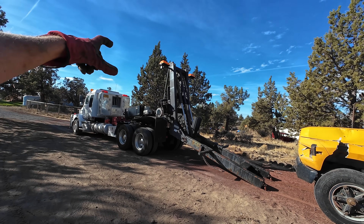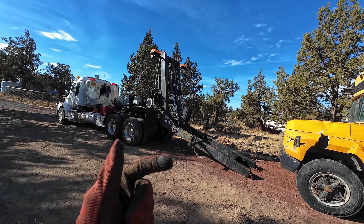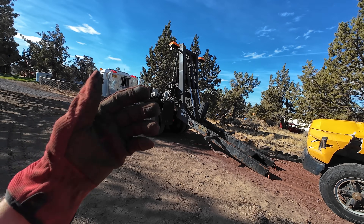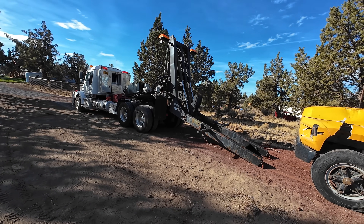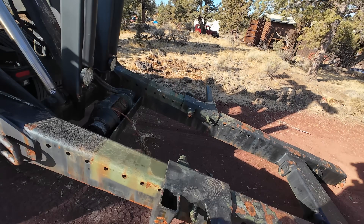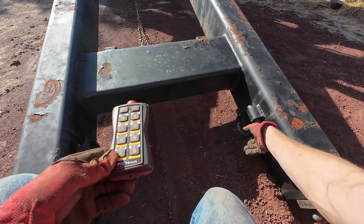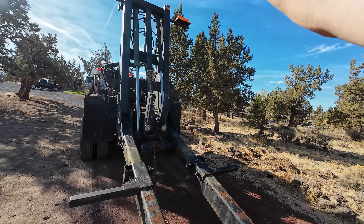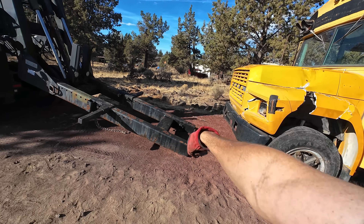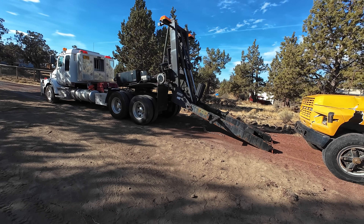On the one I kept, I put an 18,000 pound electric winch on the front and my own pulley wheel on top so I could do this. I think I only ever used it once for that, but I used an electric winch so I could run this on any truck, and it had remote control. That's one of the recovery options. The other is you could use the 10,000 pound bottom winch, and then snatch block back to any of these D-rings, wrap back around this big bar, run a snatch block and chain to the top of the mast - you've got options. Like I said, you can do a lot with this if you're creative enough and willing to work hard enough. Whereas with something like the Zach lift, you just do what you want to do and it's easy.